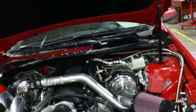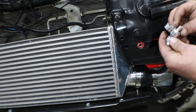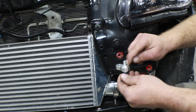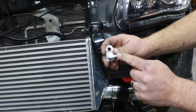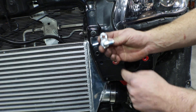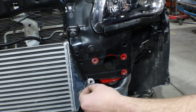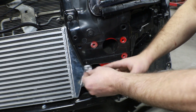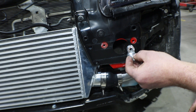For the dash-4 line we're going to follow the same routing over the fender well and shoot it right down to this corner of the AC condenser on the back side. This fitting for the AC condenser — same thing — we're going to reuse the O-rings off of it and it's going to bolt up in there. This has an eighth-inch NPT to dash-4 in a 90-degree bend, and the straight side of our high-pressure dash-4 AC line is just going to come right into the side of it here, bolting up exactly where we pulled the existing line off of.